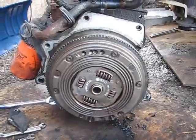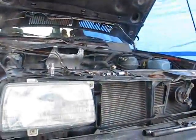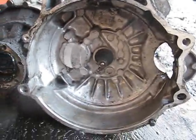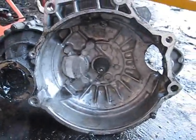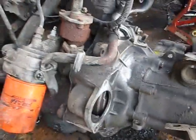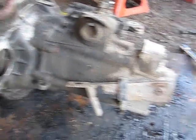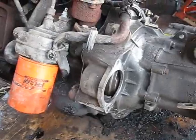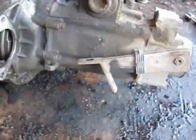I got the clutch all put back together — it's all cleaned up as good as she's gonna get. Now I just gotta clean out this guy, then I can start slapping it back together and get it put in. I used a can of carb cleaner and a quarter can of brake cleaner and she's as good as she's gonna get. She's starting to take shape — gotta put the starter in. I don't know if I'm putting the starter in until I get that guy all situated, cause it might be a bit of a pain to get in once the starter's in.